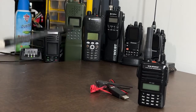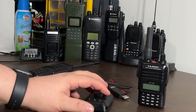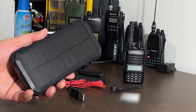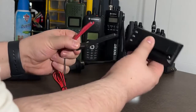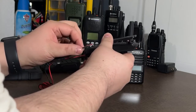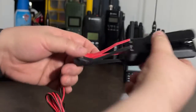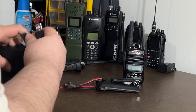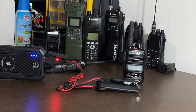We're actually going to take this battery from this unit, pop that off because we know it's completely dead, and go grab a charging bank. All right, I'm back here with a power bank. What you're going to do is attach the negative lead and the positive lead. You want to make sure they are on the contacts — not over the contacts — as centered as you can be. Place your battery down, plug it in, and you're going to see the light turn red. As long as everything's connected correctly, you should see the light turn red and stay red.